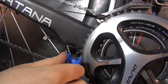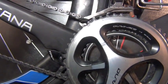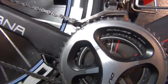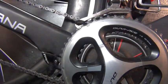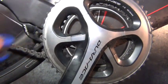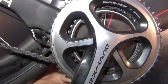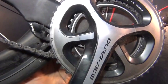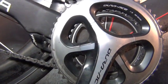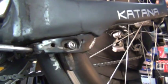What you'll notice is the brake doesn't really move with that one adjustment — that's why you have to pump the brakes a couple of times to see where it ends up. After pumping and spinning, the left brake pad is hitting first. So we loosen this off a little more, but we still need to move more to the non-drive side. So we're going to go to the opposite side and tighten up that bolt there just a little bit, which should bring it over.